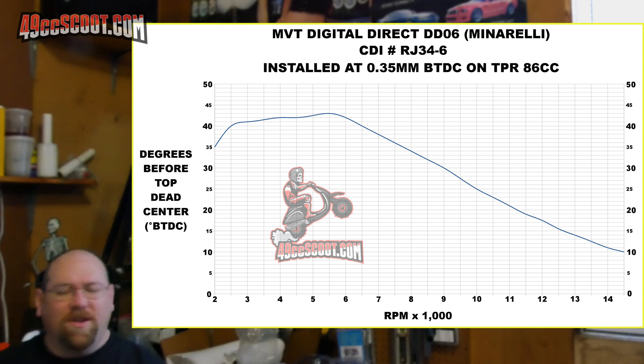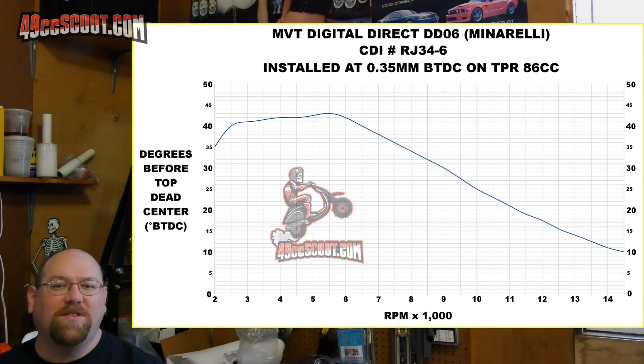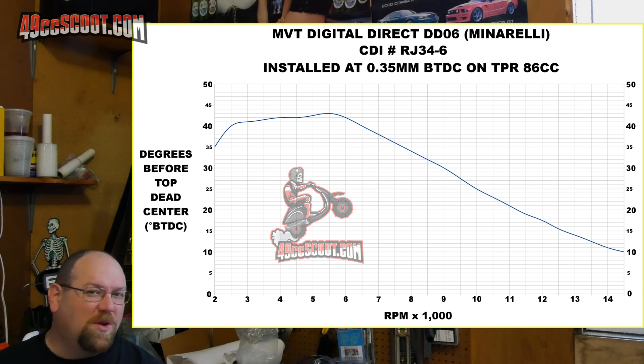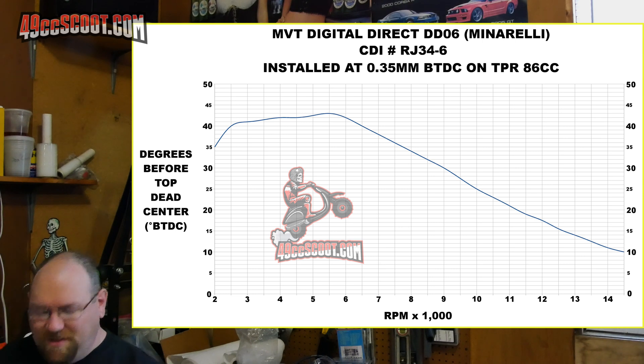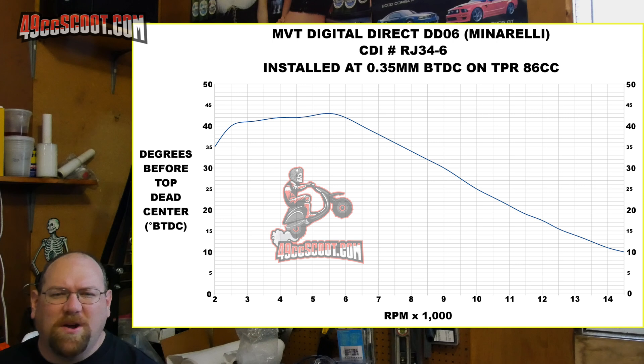There is a possibility — some people say — that the circuitry of a timing light making the bulb flash can naturally cause it to show ignition retard as RPM increases because it basically can't keep up, so accuracy could be a little off. Between 2,000 and 2,500 RPM you can see it's ramping up really quickly — that's kind of a guess on my part, because no matter what I do the ignition timing jumps around a lot at idle around 2,000–2,500 RPM. I think it's probably a pretty low timing that they ramp up quickly, to help it start easier and not run backwards if timing is too far advanced when kicking it over.